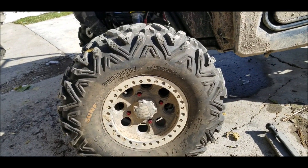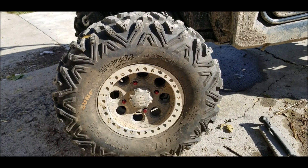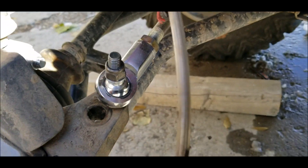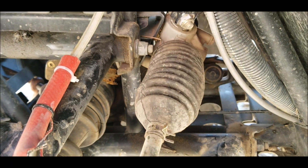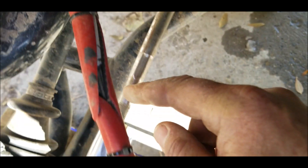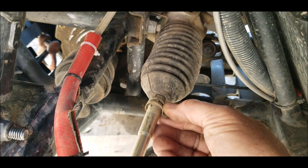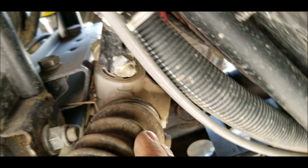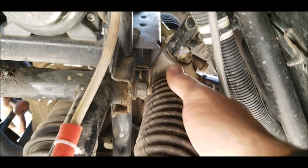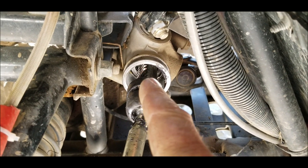We'll pull the tire off just to get easier access to those tie rods and tie rod ends, and show you some differences between the 1,000 and the 570. Here are those American Star heim joints I put on, because the factory tie rod ends were worn out. Here's your factory tie rod — pretty small diameter — threaded on one end for the tie rod end, and the other end has a ball and socket that goes into the rack. The boot is pretty easy to get off — just slip your clamp off, and there's a zip tie from the factory on the back — snip that off, twist and pull the boot, and there's your factory little ball and socket screwed right into your rack.